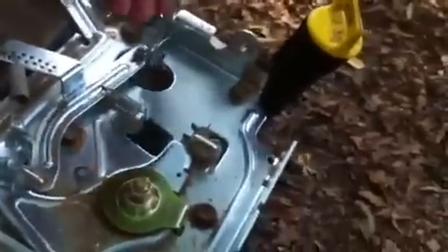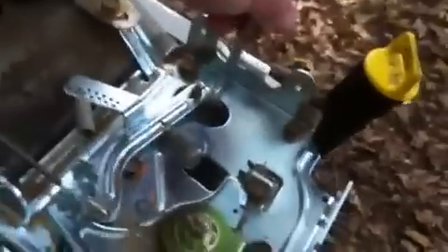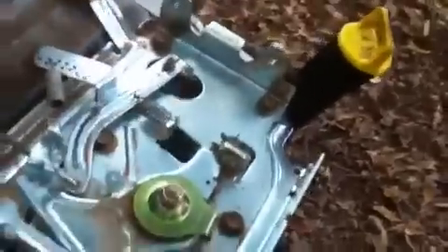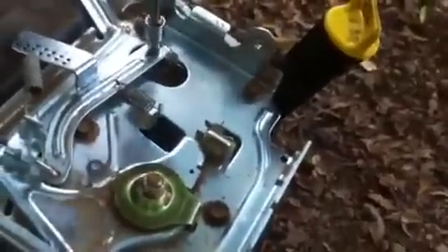This right here is the nut that you would loosen up with your 3/8 inch wrench, and here's the governor shaft that you would move with the 3/16 socket.